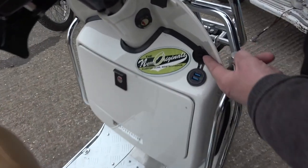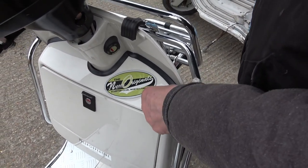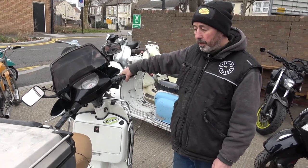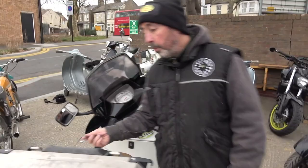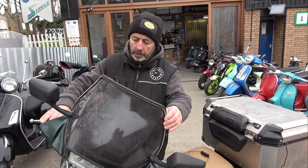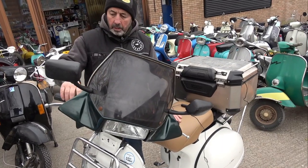On top of the toolbox are USBs for charging the phone — very important these days to have your phone charged. The bike's electrical system is a Vape DC electric system throughout, and he will need that battery mainly for charging the phone and the LED lights. Ignition is not off the battery though — the ignition is independent, so the bike will always run even if the battery's flat. There's a nice screen here which certainly helps, with mirrors on the screen — an old Spanish screen — very useful for keys or change, and his phone will be mounted here for sat-nav before he goes.